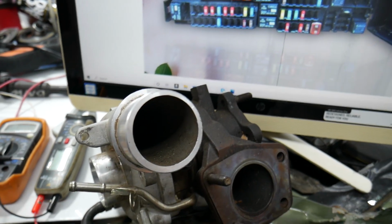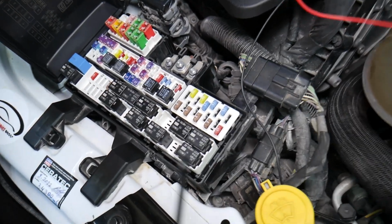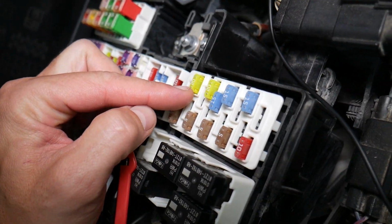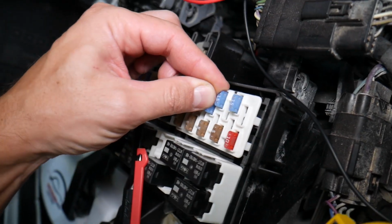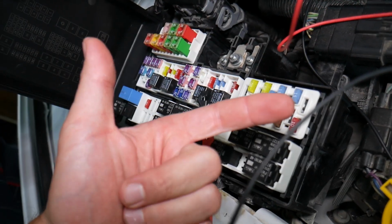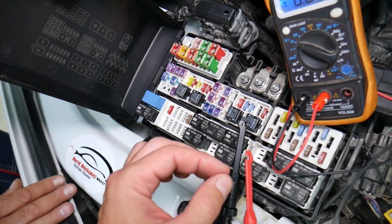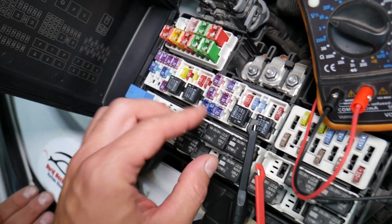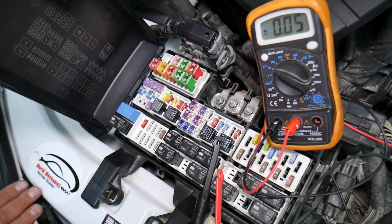Before we continue, let's explain quickly why it's always a good idea to test fuses and relays. Let me explain why it's super important to test fuses. Often you can't see if they're burnt or good. Sometimes they may seem perfectly fine, you think it's a good fuse, you put it back in and you end up spending money and time on parts and problems that do not exist, when all you had to do was test your fuse, find out it's bad, replace it, fix your problem. So we will have a video on how to test a fuse, different kinds of fuses, and how to test relays. We're going to put the link in the description of the video below.